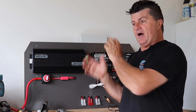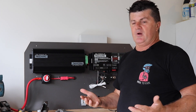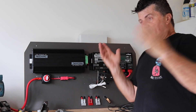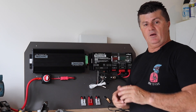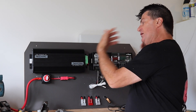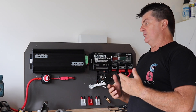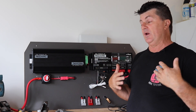What have I bought apart from the RedArc unit? I've bought an isolation switch - self-explanatory. I just figure it's a really good thing to be able to isolate the battery bank from the electronics and the rest of the camper at a moment's notice. I've bought numerous Anderson connectors, because I wanted this to be able to be taken out as we're going to add to it as time goes on. So because all the wiring's behind this panel, it needed to be able to be lifted out quite quickly.